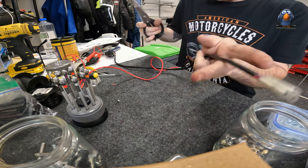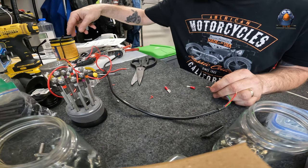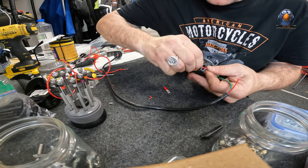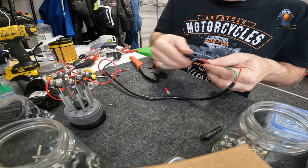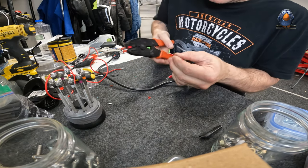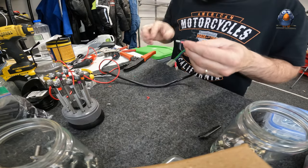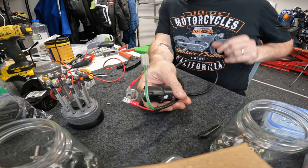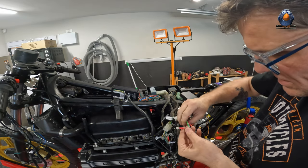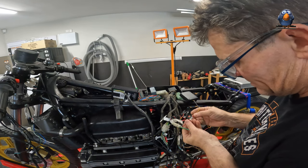That's the red one we have to splice, so I'm just going to pull this back a bit. Pull test - next one. Hopefully it works - it'll be a shame if it doesn't, that would set me back. Pull test, pull test. So first off, this goes back - this is the ignition key that goes back. The red is spliced and orange goes to the bike. They fit male to female which is encouraging.